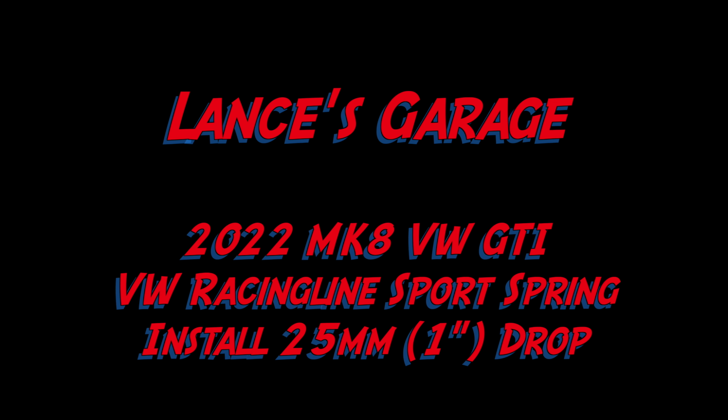Change of plans. We're going to just go ahead and do it one side at a time. You need to get yourself a spring compressor, either rent them, or this is the old Harbor Freight ME41 Maddox spring compressors. You need these to compress the spring so that you can pull the cap off and install the new spring on.